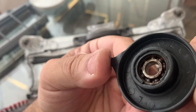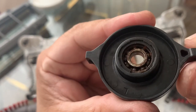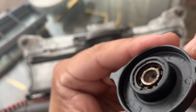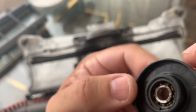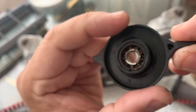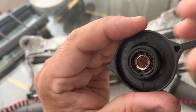It's these little bearings in here — they seize up. If you can see on this one, there's a bunch of rust. Obviously this unit may have been used with water or in water, which is not what you want to do with a Dyson. I'm not sure I can turn it — I won't be able to turn it now. What I'm going to do is clean this up and lubricate it with WD-40 or lithium grease, and I'll come right back.